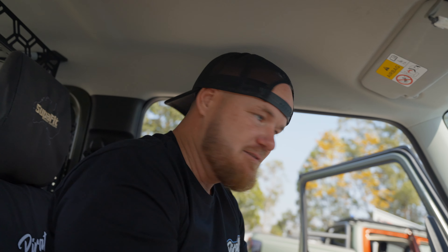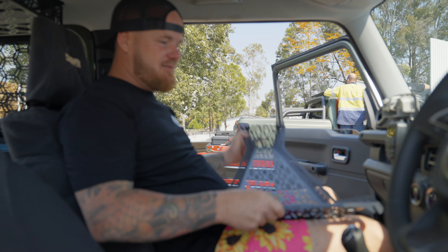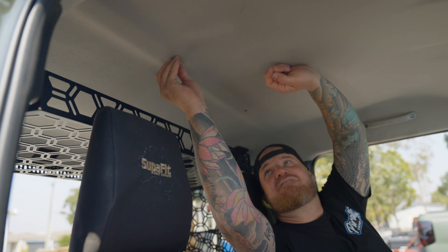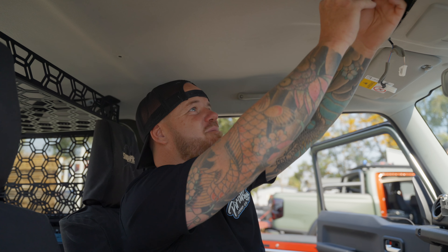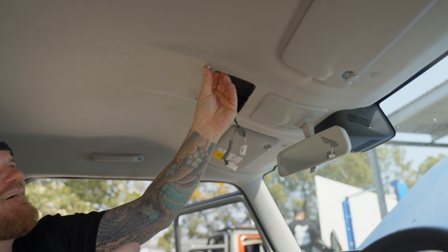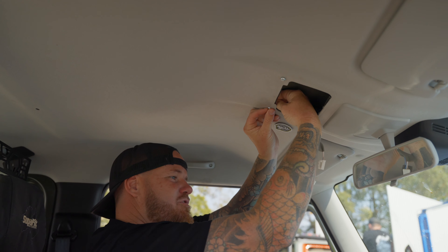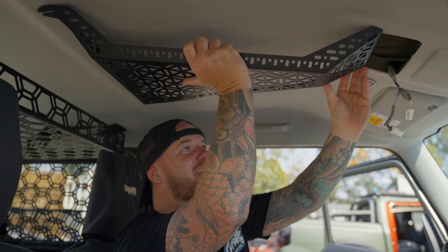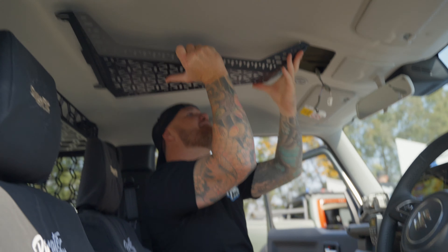So we've got a couple of things to do. You'll see we've put a couple of slots there so we just hang the bolts and slide it in - that's the theory. We're going to go ahead and put the first bolt in there. When you put this bolt in, put it in from this side, then we'll put the washer and nut on the inside and put the 10mm spanner up in there. I love this car - if you can't tell, I really do.